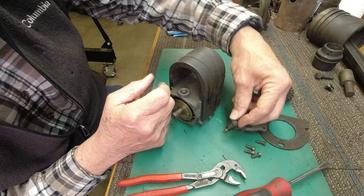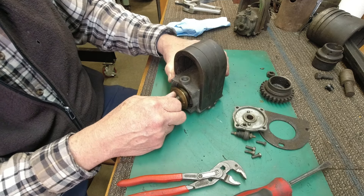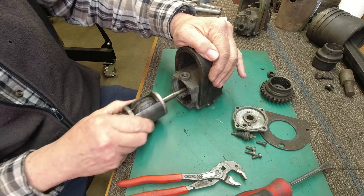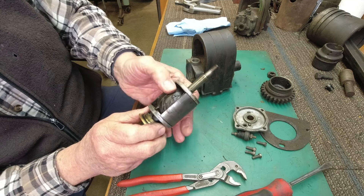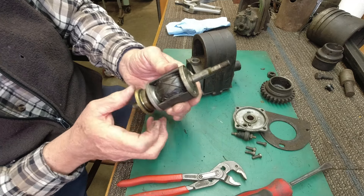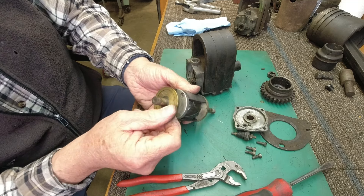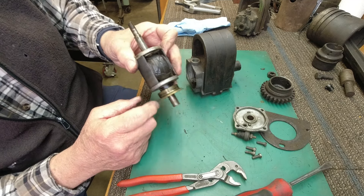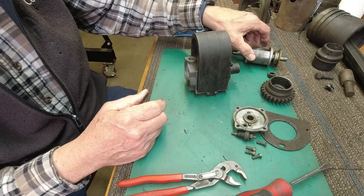What you want to do is make sure you've got continuity between this brush and this terminal — I'll check that before I go back together. Everything's got to be cleaned up. With that brush out, this should pull out. Get the magnets aligned where they're not fighting me. Here's what I'm going to call the armature — it's got the windings on here nicely wrapped up. I'm not going to get this wet or get solvent on here, but I am going to clean the rest of the magneto. I'll clean the slip ring, both contact surfaces, clean the housing up, lube it good, and put it back together.